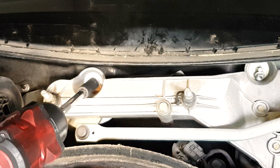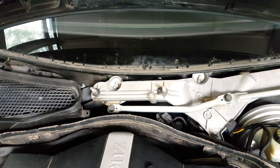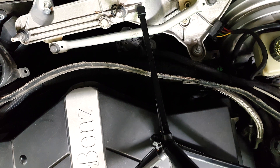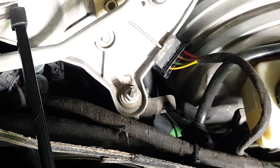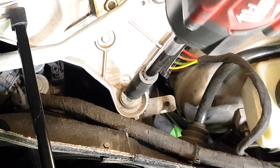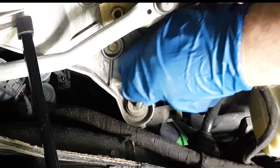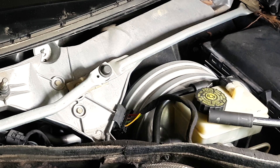I'll have socket extensions in the description too — I don't think they're very expensive. This is the last of the four nuts, and right underneath this nut there is a washer that you have to remove. Underneath that there's a narrowed nut — don't twist it, or the incline angle of the wiper system gets changed. So don't touch anything underneath that nut.